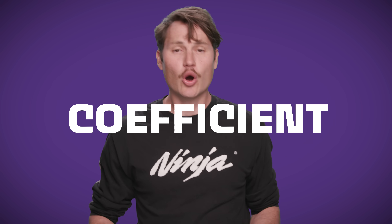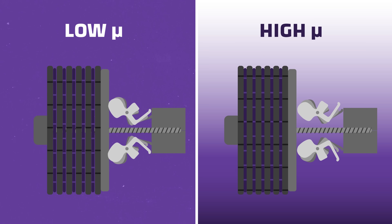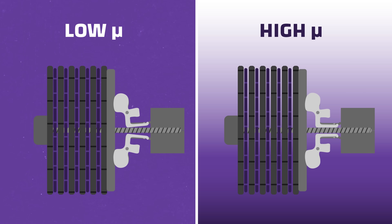Let's talk about the coefficient of friction — how well or how poorly friction exhibits itself between two objects. A higher coefficient of friction means the better a disc will be able to do its job. It also means a super harsh engagement, so more parts are sacrificed, but it's worth it so you can go faster down the track. The same sintering process that strengthens the material for more grip makes it ideal for welding.